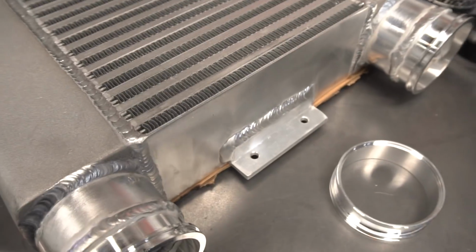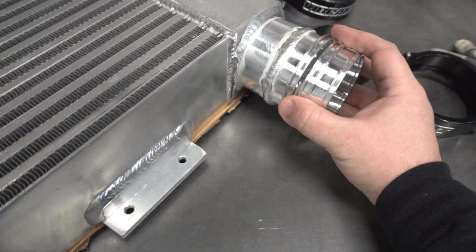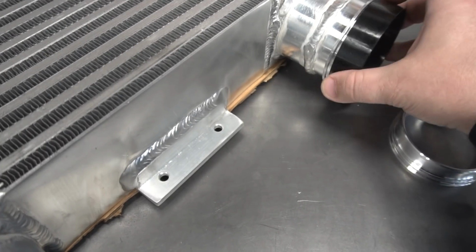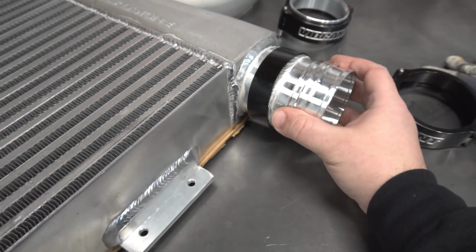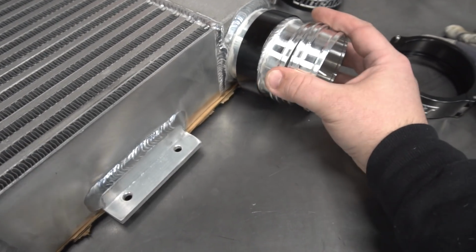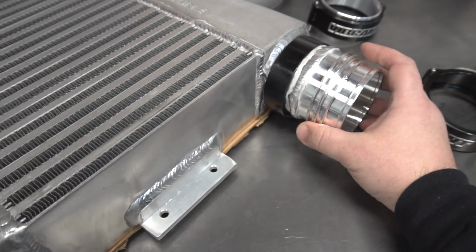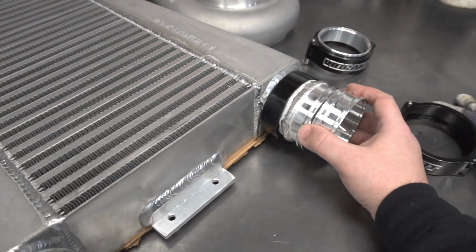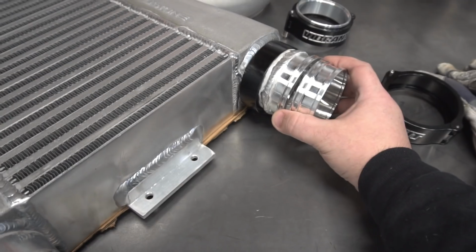Check this out. I didn't know between these two ferrules, there's supposed to be a gap. It's not supposed to be flush and then you kind of tighten that. There's a gap there, and that ferrule piece and the center band goes in there and allows for radial movement up to 12 degrees. And if you don't have that, if you butt it up and that's your fitment, and you tighten it and you put this clamp on top, this thing ain't gonna move, and it's gonna really wear on these joints and potentially fail depending on how much the engine moves. We have 034 pretty much locking down the engine as we did on the 5-cylinder, but I'm just wondering now, number one, I would have just been fitting this up flush. I had no idea that it had to be a pre-gap.